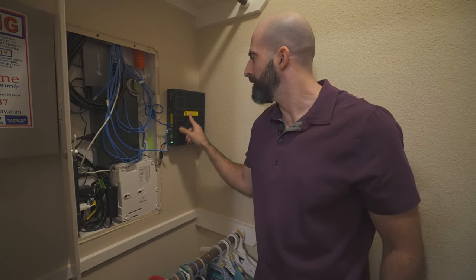Okay, back at our desk — we essentially have everything configured now. Everything's connected. This is the user guide for the controller we're looking at, and you can see the typical network topology, which we are following essentially to a T. We have our modem, connected directly to our router, our router to our switch, and from our switch we go to our hardware controller and to our access point — exactly how they have it listed.